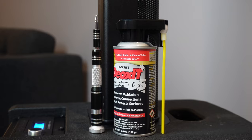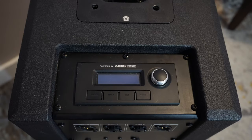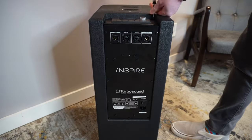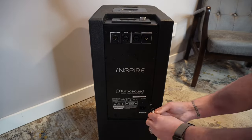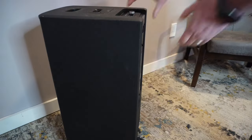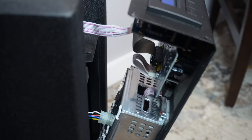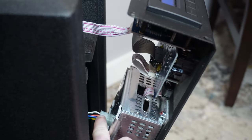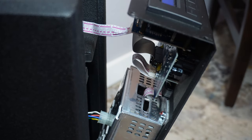To complete this repair, you're going to need two items: a Phillips head screwdriver and some contact cleaner. Once you've disassembled and powered down the unit, you're going to remove the five screws from the top lip and 12 more screws on the back panel. Don't forget that random one in the middle. From there, we will unplug the back panel from the base unit. That back panel has a ribbon connector at the top and then the speaker connector on the bottom section. Go ahead and unplug both of those.